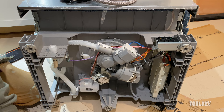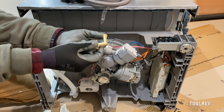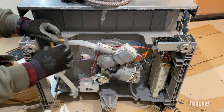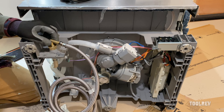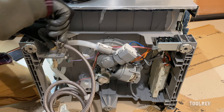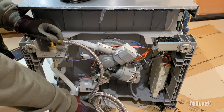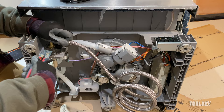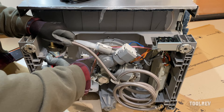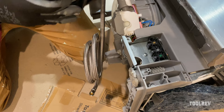Here are the fittings that came with the water hose. This is a six-foot braided water line with three-eighths connectors. For this install we just need this elbow piece — I'm going to hook that onto the dishwasher. Don't tighten it up all the way yet. I'm going to make our water connection, slide that on there, and go ahead and tighten this one down. Figure out which way you want this to go, tighten it as much as you can by hand, then cinch it up — about three-quarters of a turn past hand tight.